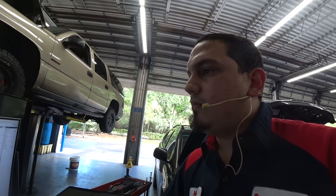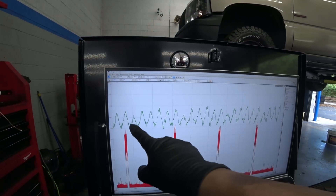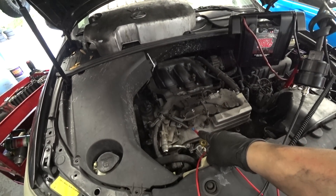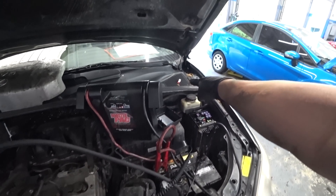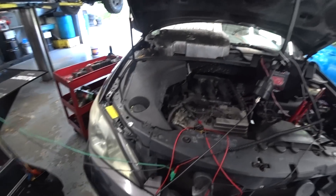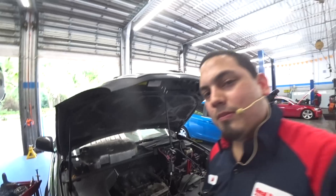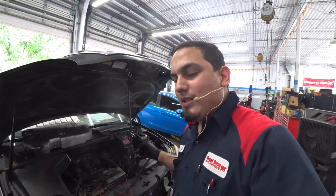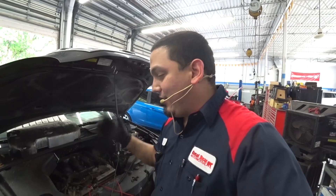When I saw a failed RC test, let me set this up — I had seen this: low compression right there. We are synced to number two, right here on the number two coil. I've got my amp clamp on the positive side, my injector fuse is pulled right there, and the jumper just in case. This is a pressure pulse sensor — this one I'm trying out is from Cody from Cody's Auto Diagnostics. Thanks, bro — he sent me this one and it works great.